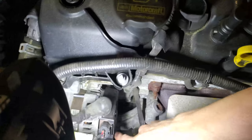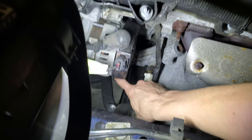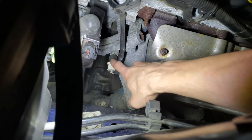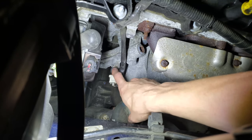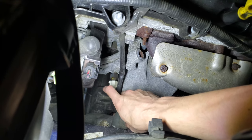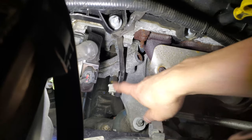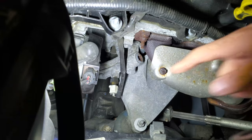So the oil pressure pump is somewhere in the front there. The oil pressure goes through the filter and then goes through this pipe here and into the block, and that's where I'm gonna tee off the oil pressure sensor of this switch. So this is actually also an oil pressure switch, but it's more binary, so it's only on or off if there's oil pressure or there's nothing. So I'm gonna keep it here, tee it off, and have two sensors coming out of here.